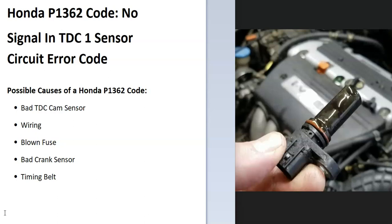What the camshaft position sensor does is report back to the onboard computer the location of the camshaft as it spins, and the onboard computer uses this for timing. Since it's seeing a problem inside of this circuit, it's going to need troubleshooting.